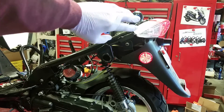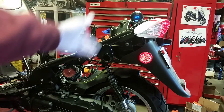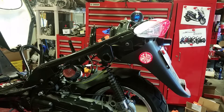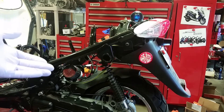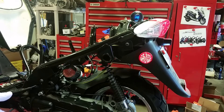Which is where we want. See, it's bouncing around — it'll go off to 15 then drop back down to 13. Actually it's going in between 14 and 15. That's showing I'm a little lean. If you go above 14.7 you're lean; if you go below 14.7 you're rich. Oh, there it did — it just dropped down to 13.